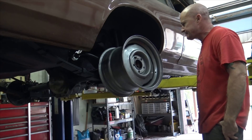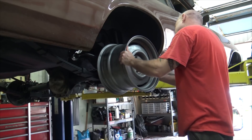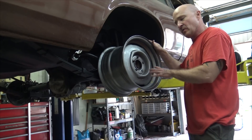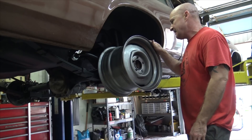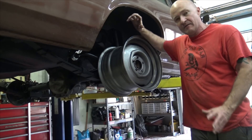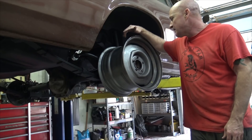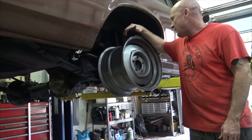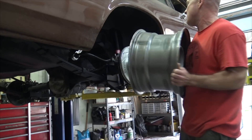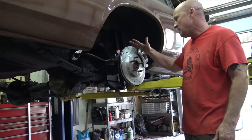Totally hitting the caliper. So the deal with these wheels is if you order a custom offset, it's yours forever. I talked with the guy at the store and told him here's what I'm doing with it - it's going over this axle and these brakes, and I've measured all my offsets. He said that would work. But the face of this does not fit this Mustang caliper at all. It's too shallow and it dives in from the barrel too much.